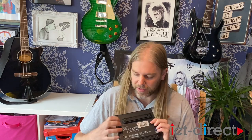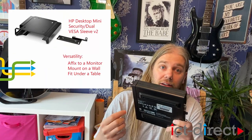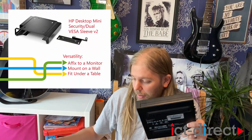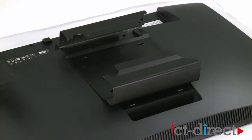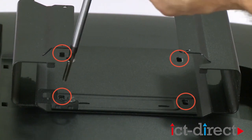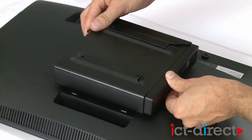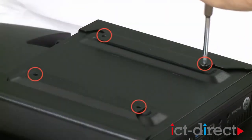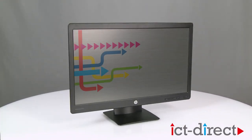You'll notice as well it's got the VESA holes at the back. This allows you, along with the HP VESA security mount, to mount it to the back of any monitor that has got 100mm VESA mounts free on the back. Providing there's no stand there, you can fit this into the metal cage and then securely fasten it in using the two sets of holes on the back, and then you've got yourself the perfect little, very quick, all-in-one solution.